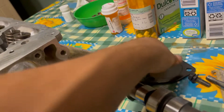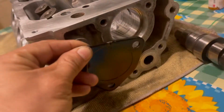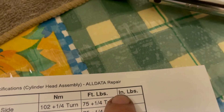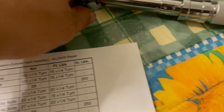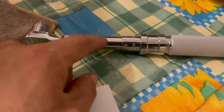I already have the torque wrench over here. In the back there's a plate called the camshaft housing plate — it's marked 'this side out' with an arrow pointing up. According to the specs, the camshaft thrust plate bolt torque is 250 inch-pounds, which is 28 Newton-meters. This ratchet only goes up to 220, but you can keep turning it all the way up to 250.